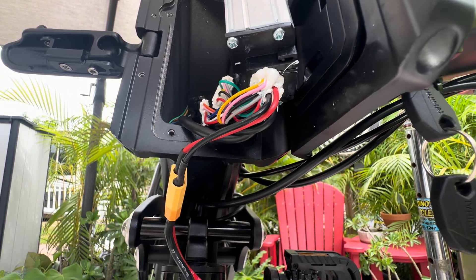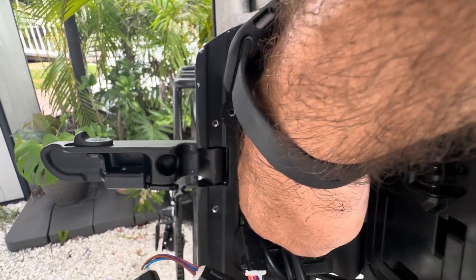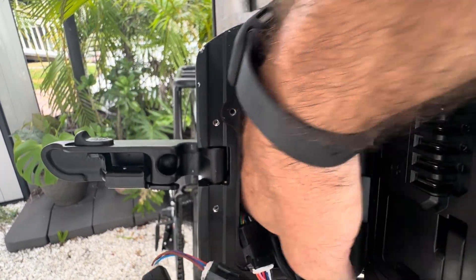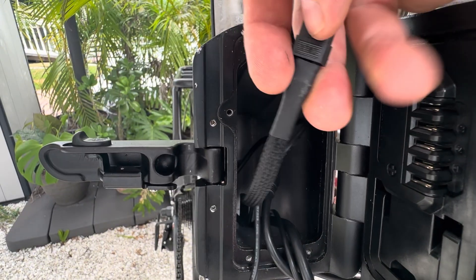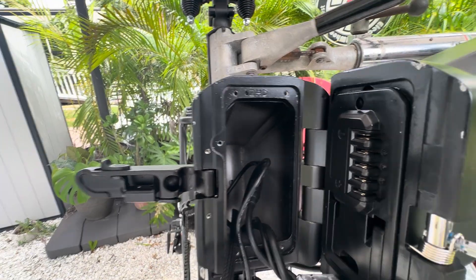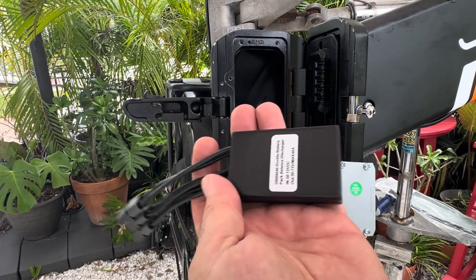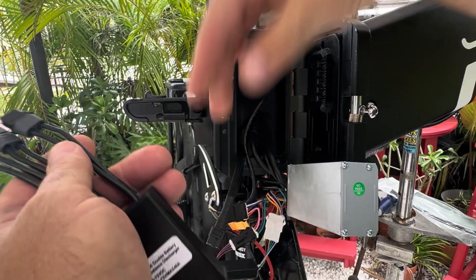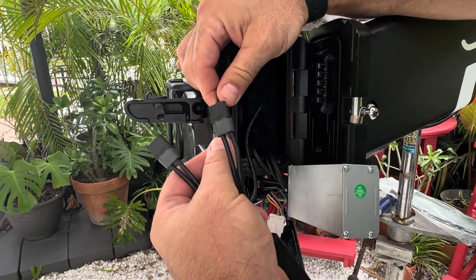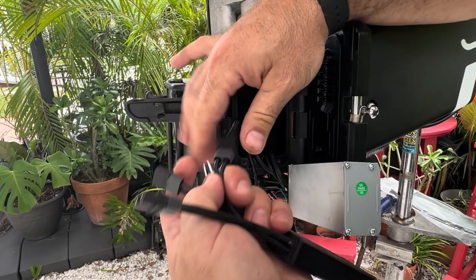We're in. I can see it in the bottom of the controller here — I'm just going to grab a hold of it. There it is. Bring it out to rest. Now I'm going to take this 40 amp balancer and plug in the second battery — this is the second battery cable — into one of the in ports for the dual battery combination.